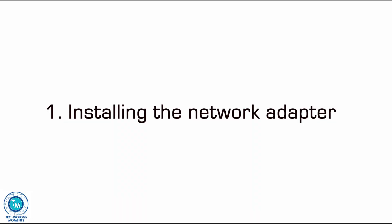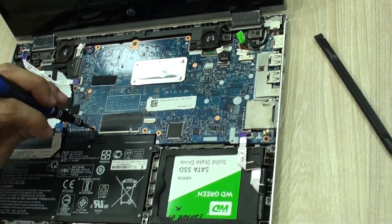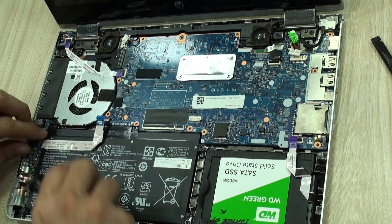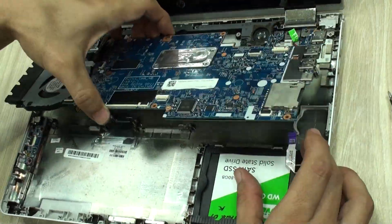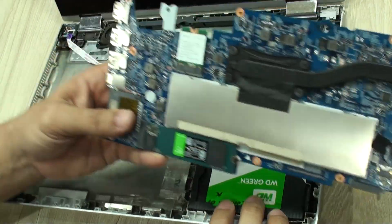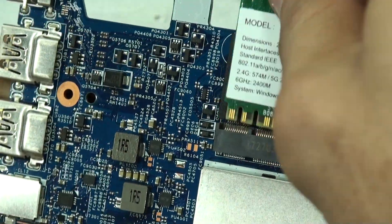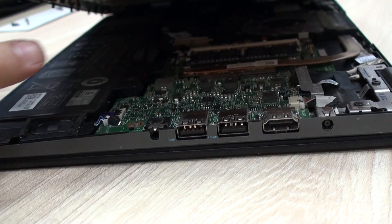Right to the point — let's go to installing our network card. After having opened your laptop, for which you may find many videos for your specific model on YouTube, you will look for the M.2 slot where your card is located. Sometimes, as with this laptop, reaching the M.2 slot may be quite difficult and you will have to disassemble and disconnect everything in your computer to reach the M.2 connector. Remember that Wi-Fi 7 cards are available in M.2 format and they are mostly E-keyed cards, meaning they will not fit in every M.2 slot — a very important aspect if you're planning on upgrading. I was actually surprised that I was even able to install this card in this older HP laptop, which features an i3 7th generation processor.